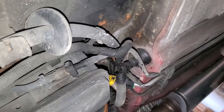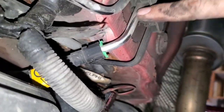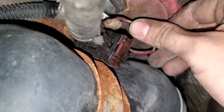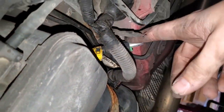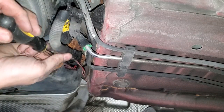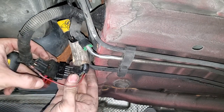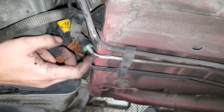On the passenger side of this left-hand-drive U.S. spec car, there's a fuel line with a little symbol denoting it as the fuel line — so we need to disconnect it. There's also an electrical line here. I noticed last time I was in here that one wire runs outside of its loom, which is bizarre. I'll use a screwdriver to disconnect the fuel line. I have a drain pan and a face shield just in case we get any fuel spatter.